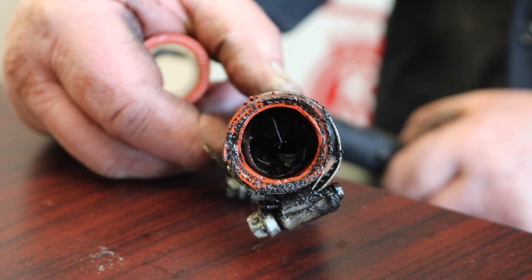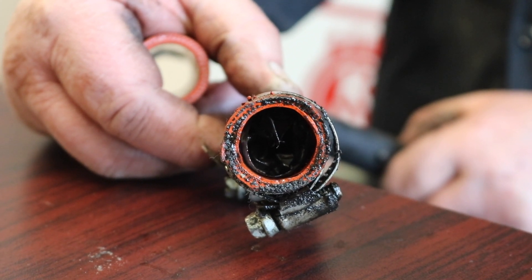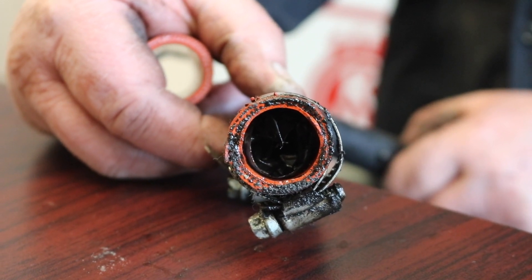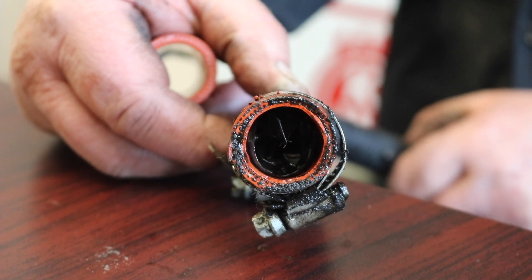Somebody left a piece of tape across the bottom of the drain tube so they could paint the turbo — the gasket gets crooked in there, something weird happened. You always want to make sure you don't have a blockage in a drain tube because it'll give you a false bad turbo indication. All right, Brian at Pittsburgh Power, thank you.